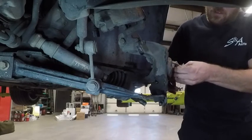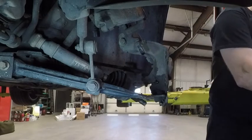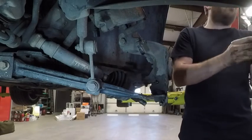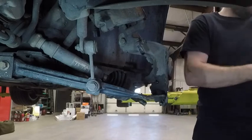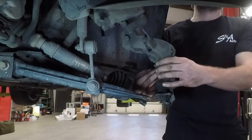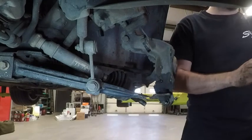Okay, three broken bolts, LOL. Need to weld nuts to it to take three broken ones out. Brutal on each side. Yeah, we do that, and then we also use the Beidler CNC manifold driller kit. That's an easy way, not easy, sometimes there's not room for it, but it's a good way of getting those bolts out if you're not good at welding.